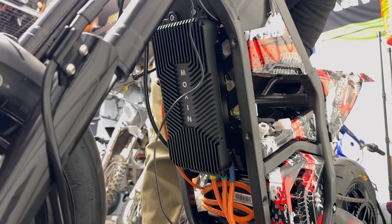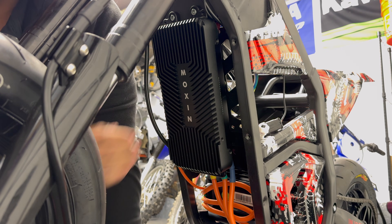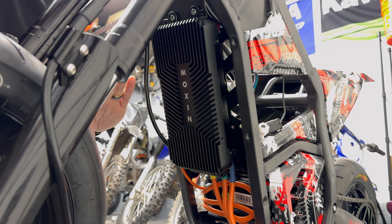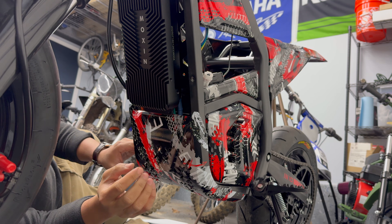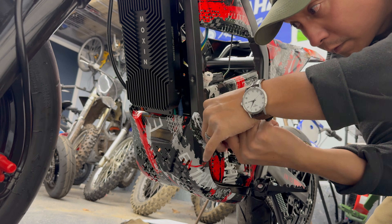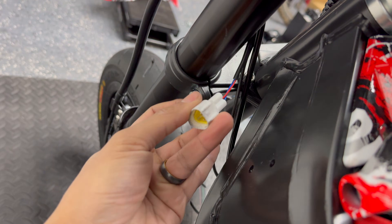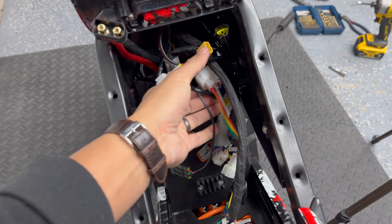I completely forgot to feed the left and right control plugs, but luckily there's just enough of a gap to fit them between the frame and the controller. All this empty space around the controller will be filled once we reinstall the covers — I'll need to cut quite a bit of material from the center, which we'll do when cleaning up in the next video. The skate plate clears the controller fully and the phase wires have no additional tension. I was able to pull everything through above the controller except for the factory headlight switch, which I'll sort out next video along with a voltage step-down converter for 12-volt lighting accessories.